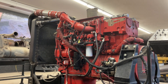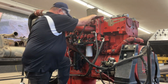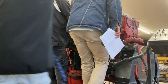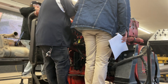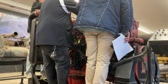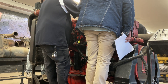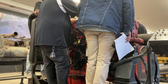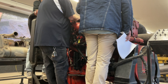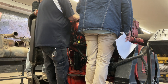What we have right here is a Cummins ISX engine. This is a dual overhead cam engine, so it has two camshafts in it. One camshaft is controlling these rocker arms that handle intake, exhaust, and the engine brake. This is the older ISX, so they still have a cam for the injector. You have one camshaft that's just for the injector. If you had an ISX from around 2015 or 2016, they went away from this and went to a high pressure common rail, which means they completely eliminated this camshaft.